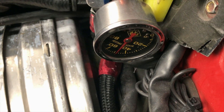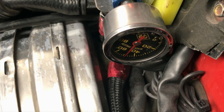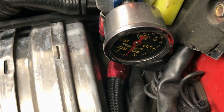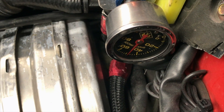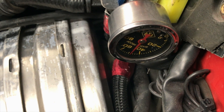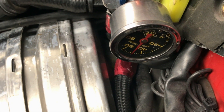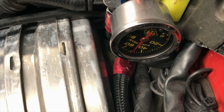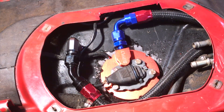Here's our fuel pressure — as you can see it's close to 50 PSI. Our injectors are specced out to about 50 PSI, so it's right in the ballpark. Pretty constant flow, not much variation. Everything's running smooth, the pump is doing great — everything's working as it should.